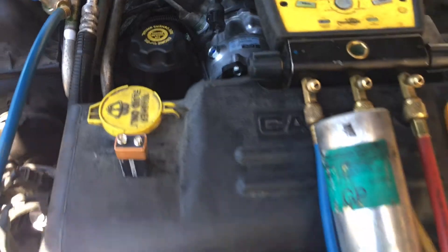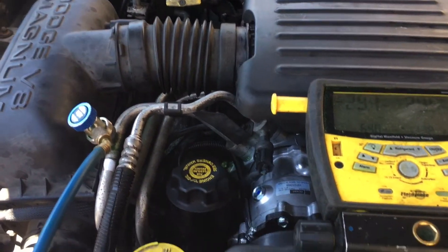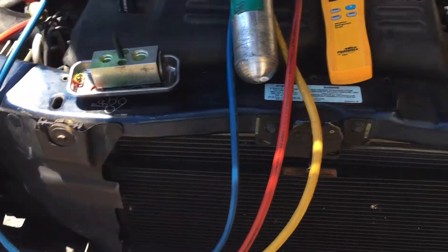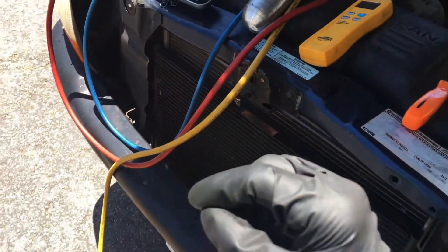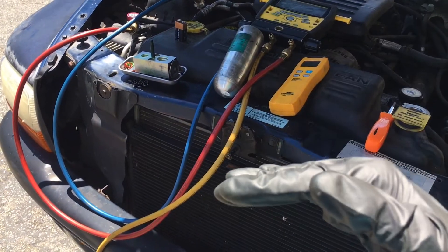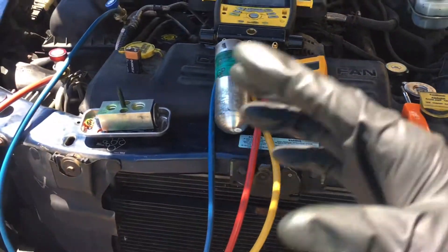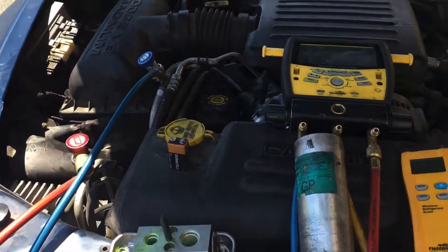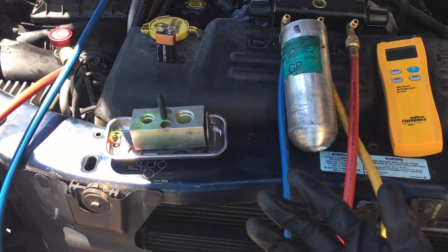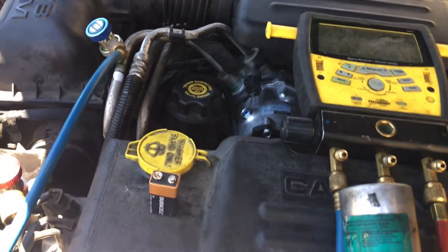About to perform the recharge. I'm about two shops behind on time this morning because I had to stop by to give my son a hand on a commercial job. On that commercial job — because of the recovery tanks I did a video about drawing a good vacuum on them — it ended up having a leak under pressure and I lost some of my refrigerant as I was trying to weigh it out to figure out my leak rate, to get an indicator since it's a variable compressor and you don't just do superheat or subcooling on them like a normal system.